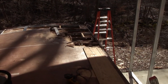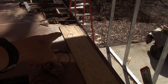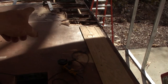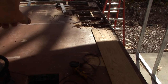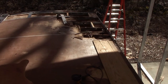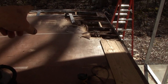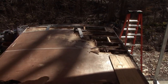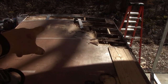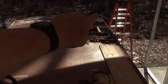That's such a big area because it actually comes all the way back up under this piece of plywood right here a little bit. So I think that's what I'm gonna do there. We're just going to probably cut this out 4x8, because that's 8 feet. That's perfect. So I'll just cut this off at 4 foot right here. Last sheet right there. I'll do my cross pieces for the joint right there. And then back there, you get a whole half a sheet across the back.